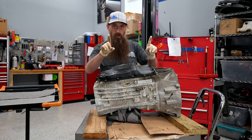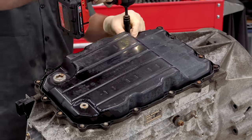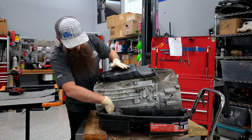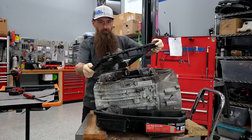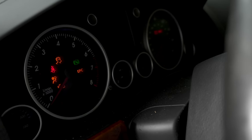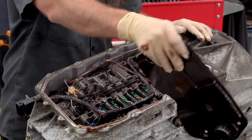Before we start taking stuff apart, a couple of things to note: we have the torque converter out, which lives right here. This is where the engine would bolt up, and because this is an all-wheel drive vehicle, this is where the transfer case would bolt up. Now that I have it flipped upside down and it has leaked all over my shoe, let's go ahead and take the transmission pan out. Our first check is almost always going to be to look for metal in the pan. It looks pretty good — there's five magnets with the normal goo that gets on them. This Touareg had like 130,000 miles, give or take. Let's get the filter off next.